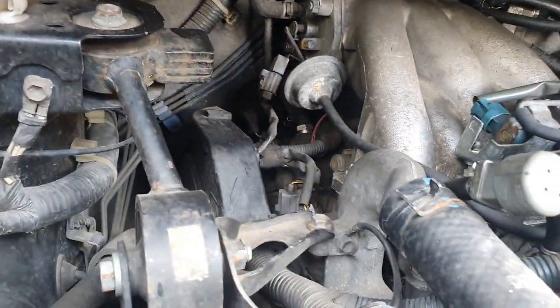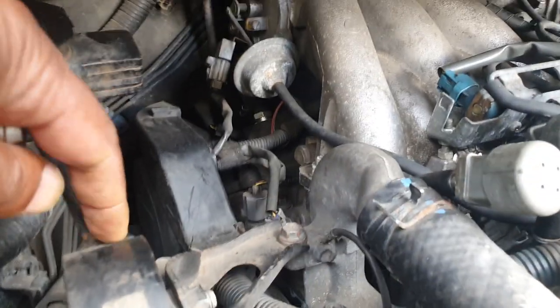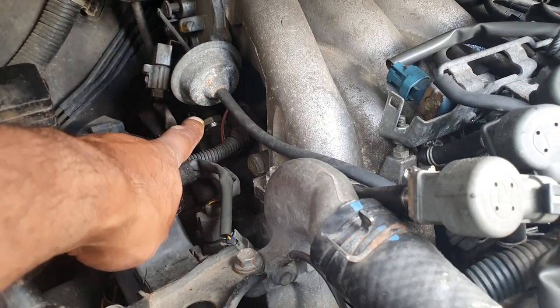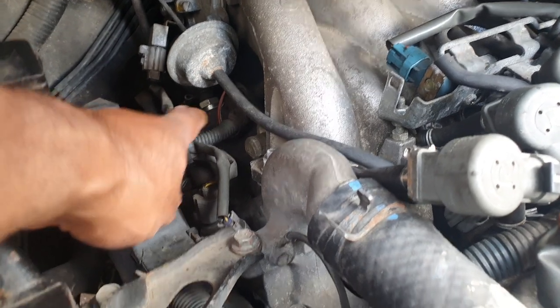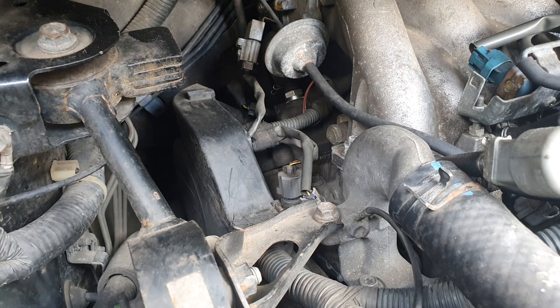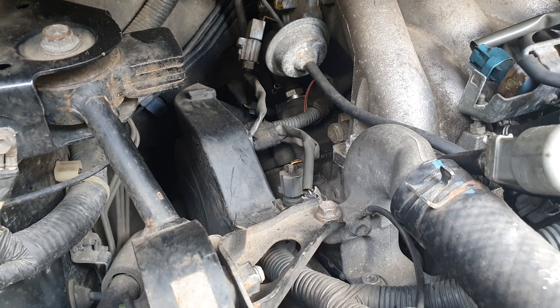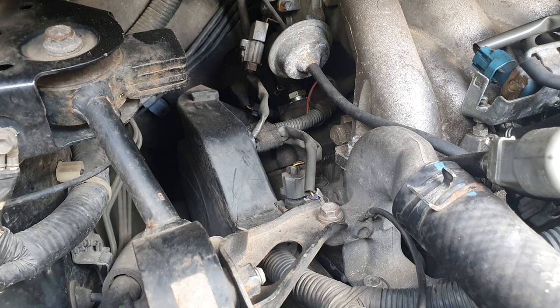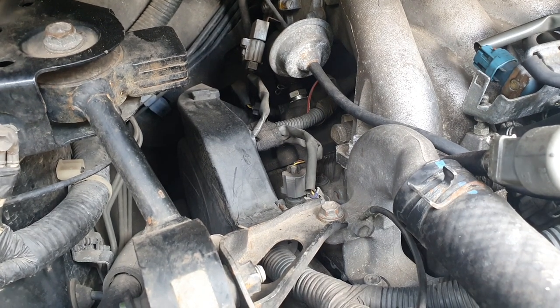Going down here, all the way on to here, and just behind there — that's it, hidden over there. What that valve does is it feeds back any gas which has built up in the crankcase that's seeped past the pistons, and feeds it back to the intake.